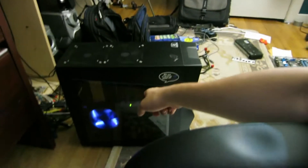I'm a little worried because I'm gonna be overclocking via the base clock strap instead of multipliers. There is a potential for data corruption, which is perfectly fine because I'm just going to be running the old version of Windows I had before on this computer until I have stable overclocking settings. Then I can reinstall Windows and install OSX. One problem I just realized is this new motherboard does not have any IDE ports, so two of my older hard drives don't work in this computer anymore. I'll remove those eventually and replace them with better hard drives.